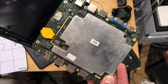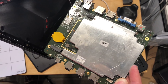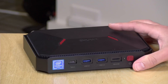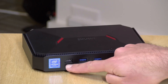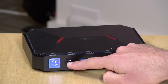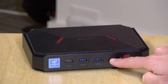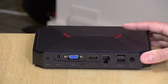We also saw on the motherboard an NVMe slot for an M.2-sized hard drive as well — we didn't test that, but it looks like it's there. So you do have some storage options, but no options for RAM or processor upgrades. On the front, you've got a Type-C port — this is data only and not video. We tried video and unfortunately it did not work. There are also two USB 3.0 slots and a microSD card slot for plugging in camera cards.